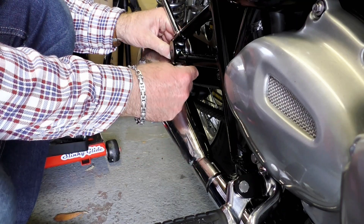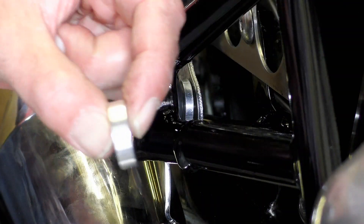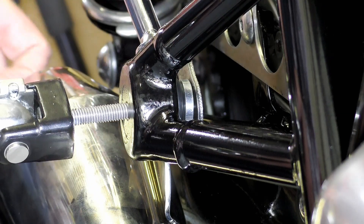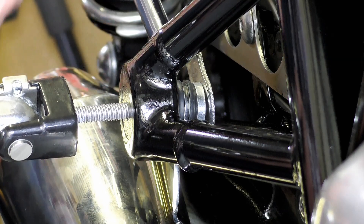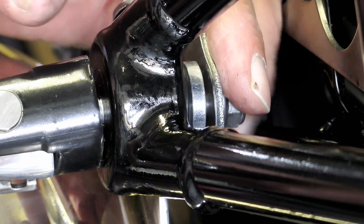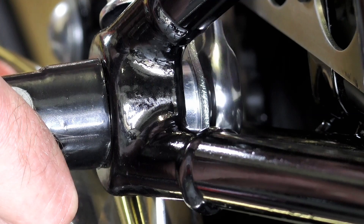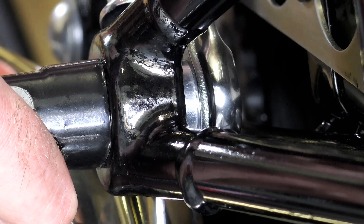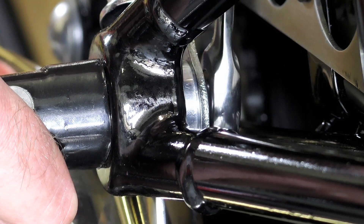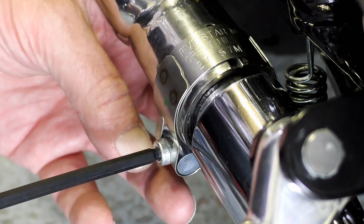A slight twisting motion helps here. Line up the hole in the silencer bracket with the hole for your foot peg, then partially insert the foot peg with bolt through the frame of your bike — as you're doing so, thread the bolt through the thicker of the two spacers and then through the silencer bracket, and start to fasten it up with the nut on the back. Check the alignment of your silencer as you go and tighten the foot peg bolt up. There should be no need to disassemble the rear foot peg — firm downward pressure should create enough friction to stop the bolt turning. Then position your exhaust clamp how you want it, tighten that up, and that's your right-hand side done.